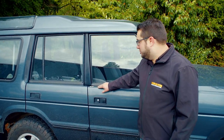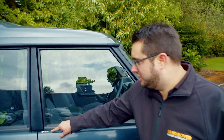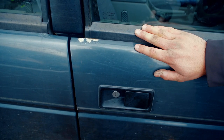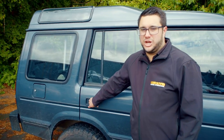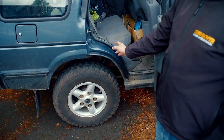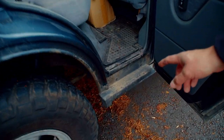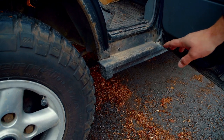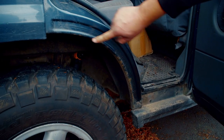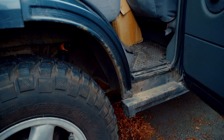These suffer from the same affliction as Defenders where they use aluminium which meets steel. Electrolysis happens here and the paint can flake off — it just looks a little bit scruffy but nothing major to worry about. Opening the rear door, check the outer wheel arch because these rust really badly. This one's been repaired before. If you look at the bottom of the outer wheel arch you can get an indication of what the sills are like. The rust comes through where dirt and muck gets chucked off the road wheel, chips the paint, and then starts the corrosion.